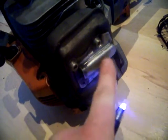It was this — in there is obviously where the exhaust comes out and it shoots out here. Because this is a really old strimmer, it was a buildup of soot and crap gathering there, and it was almost blocking half the hole for the exhaust to come out.